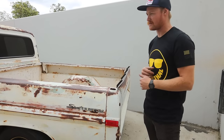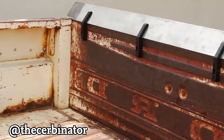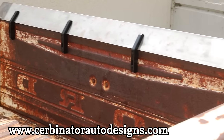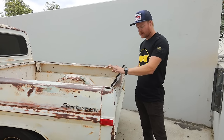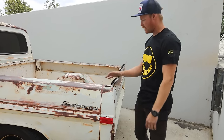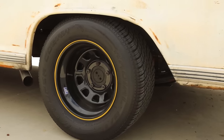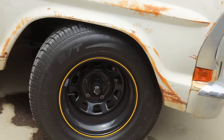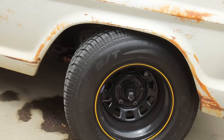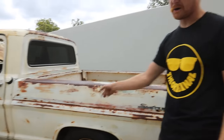Going from back to front — this has a Servinator wing by Matt Servan. I'll put a link below. It's a cool NASCAR-style wing, still a prototype since we're doing more and I'm going to change the color. The truck has a 15x10 4-inch backspace Bart D-window wheel, a 295/50-15 in the back and 275/60-15 in the front — square wheel setup, staggered tires. They're Cooper Cobras front and rear.